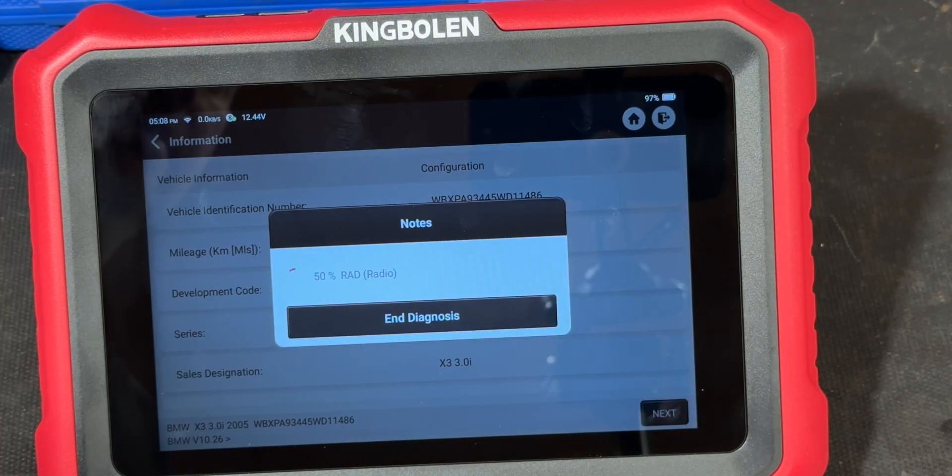So this won't have CAS - it'll still be EWS. We're going to go in manually and find this, but first we're doing an auto scan here - it's just reading everything out. Right on camera, less than 30 seconds, and it's going to read all the modules at once. Usually it takes a little longer this way since we're not targeting certain modules specifically.